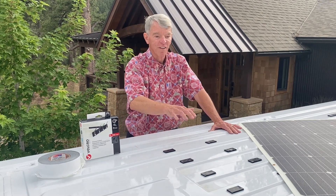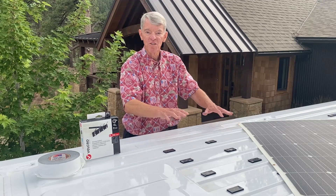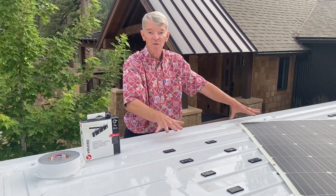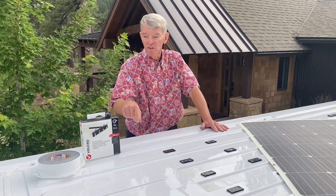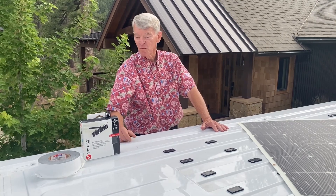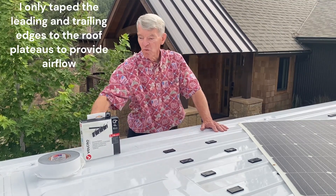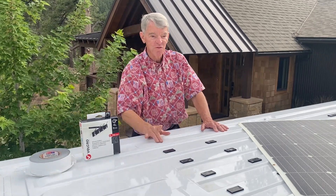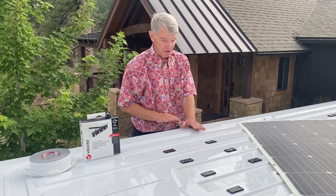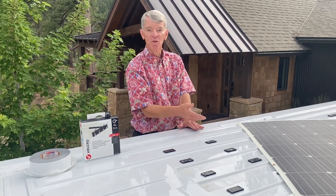You can take your time and put them down at your leisure, make sure they're in the right places. I'll lay the panels on them temporarily for a dry fit and make sure everything fits together. After everything looks good, I'll peel off the backing of the velcro, put down the three solar panels, and then tape the perimeter. This is the velcro I use — it's an extreme outdoor fastener with a higher temperature adhesive. After the panels are put down I'm going to tape the entire perimeter with Eternabond tape, which is incredibly sticky and lasts forever. Where the panels come together I'm going to run a layer of tape across to close that gap so it doesn't catch wind underneath.